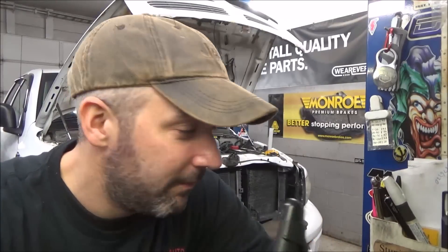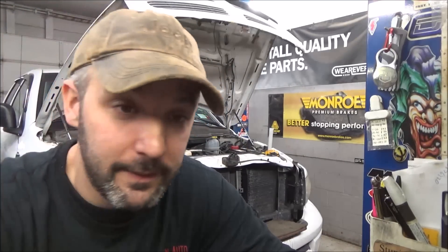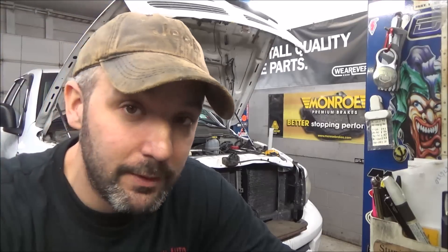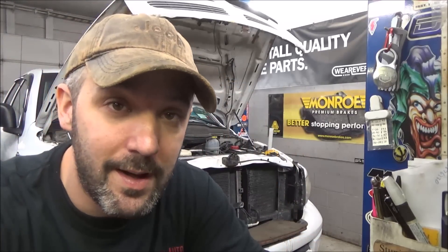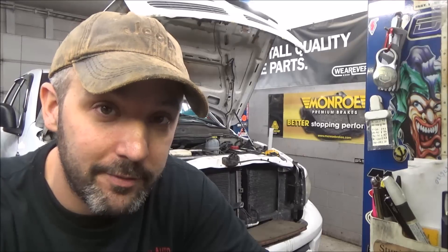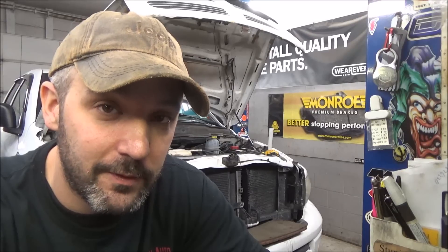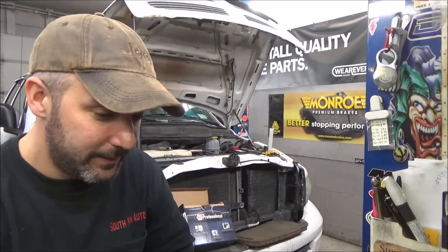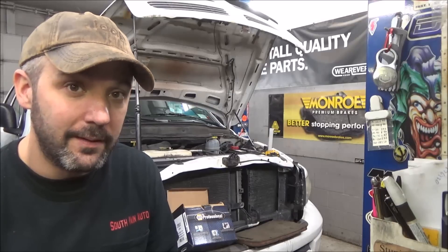Well, I just spoke to Al at Napa Temp — nice guy, pretty helpful. He did some looking. We crossed the OEM number and he looked diligently to see if we could find what we need, but evidently, whoever makes these just isn't hogging out the hole deep enough. So Al and I have determined that it is safe to put on a flat washer with a sealing surface to make up the difference, put a vacuum on it, and see if it holds. If it does, we're good to go. I should have just done that, but at least we got it right from the horse's mouth — we got it from Big Al. He says to call him back if it doesn't work and he'll do some digging, but I think we'll be okay.